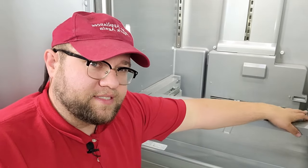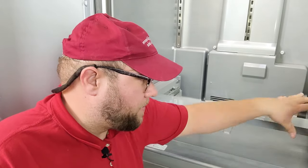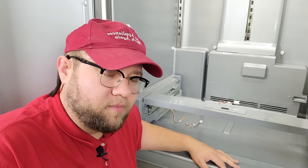So far we have all of the drawers taken out of this unit, leaving the harness system in here on this three-door unit. If you have a four or five-door unit, you're going to run into a whole lot more teardown problems. On the four doors, you will have to take this section out because it's kind of like molded in with the evaporator tower system. A quick tip on the four-door is there are going to be small holes for a flat-bladed screwdriver — press in on them and that's how you can pop the harness system on those four doors. You still have to use a similar technique to remove the wire harness.